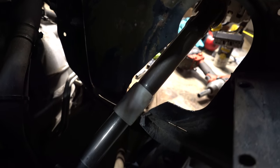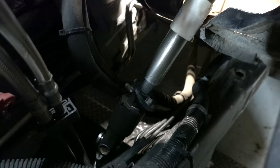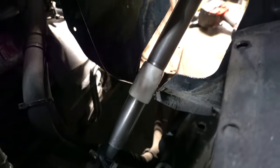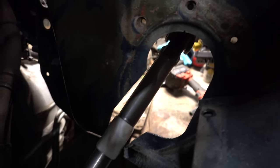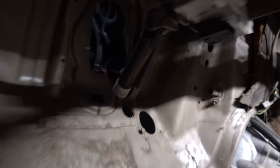There's a little notch there, and it has a pretty good angle down to the steering rack — I was surprised, I thought it was going to be a much harsher angle. It actually turned out pretty good and steers pretty cleanly. Since I changed the rack location I've got to clearance it just a little bit more. The column is a little tight at the very bottom since I changed the column angle — it still moves and doesn't rub, but I know it would rub if anything got to moving around.